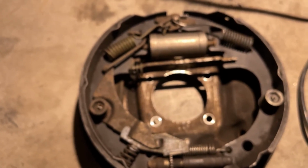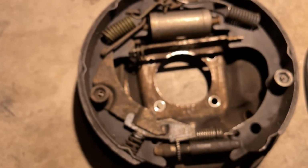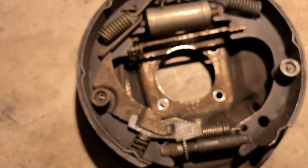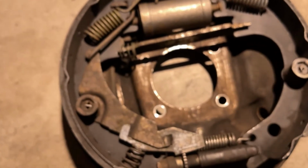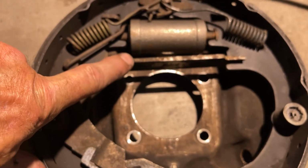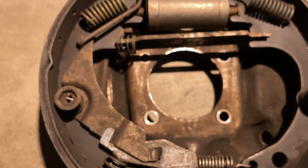All right, next up, once you get your snub cut off the end of the axle tube down to 1/8 of an inch, you want to make sure that your brake backing plate is clean on both sides. It's going to be your mounting surface back onto the axle tube and for the C-Clip Eliminator to mount up against the backing plate here. One piece I'd like to address, this emergency brake spreader bar right here, it will actually get in the way of the C-Clip Eliminator housing.